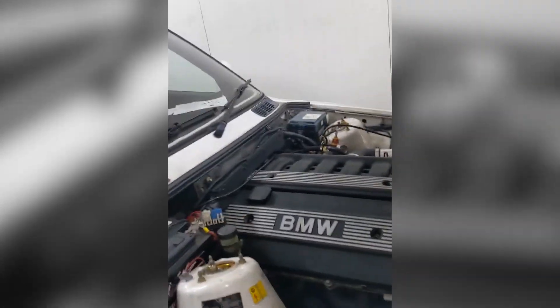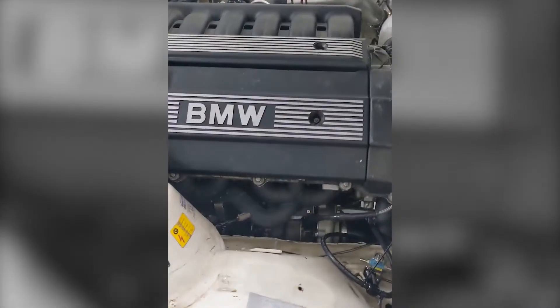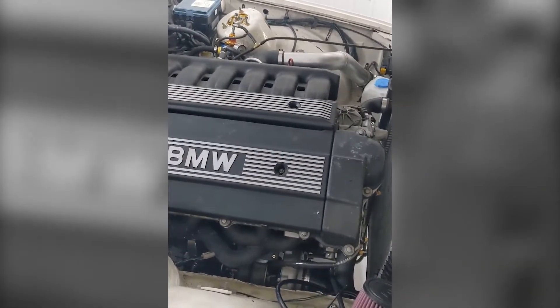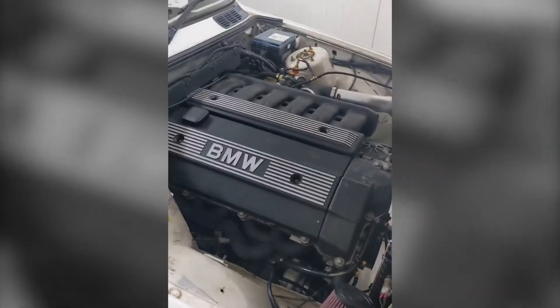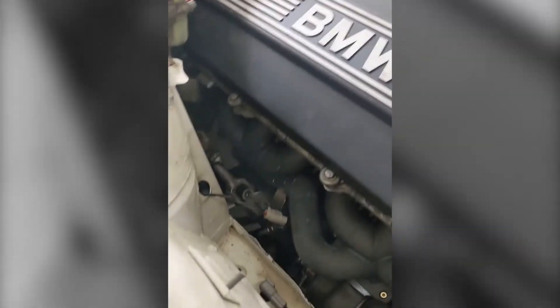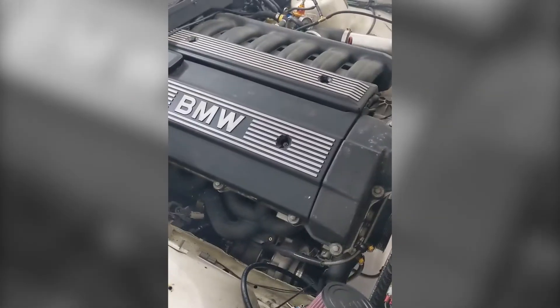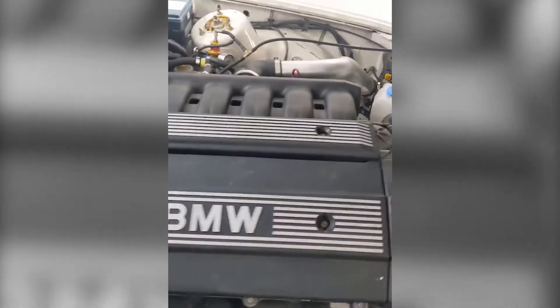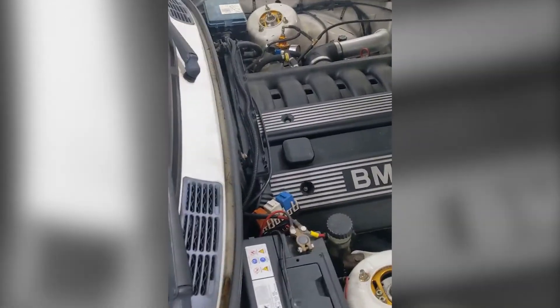So stepping back here to show you what we've got — it's a little two-door E30, early model one. It started out as a little 4-cylinder and we did an M50 swap on it some years ago and had a little Vortec V5 blower on it making 6lb. The customer asked us to swap over to a turbo setup, and we'll just show you the manifold we've designed. It's a low mount setup with a GTX30 turbo and fits in there nicely. It's a standard engine, just got some head studs on it to clamp the boost a little better, a little front mount, and otherwise a pretty rustic and reliably used car.